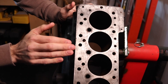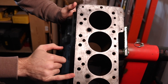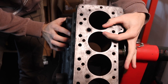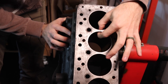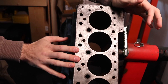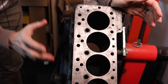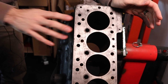It's a standard displacement, and the reason I picked a standard displacement is because I wanted to move up to 1293. With a forced induction build, you're working with boost, and what boost does is it really pushes the strength of your cylinders to their maximum. As you bore a 1275 over — whether you go to 1293, 1310, or 1380 — the sidewalls get thinner and thinner and weaker. Most folks who do forced induction builds don't go much over 1293, which provides a nice level of displacement with low risk of blow-through or damage to the cylinders when adding boost.